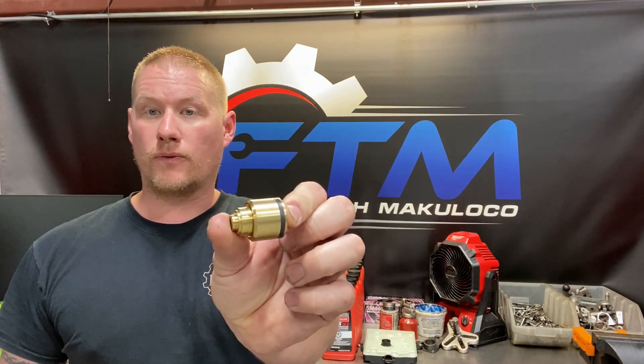Welcome back to the Ford Tech Make It Loco channel. Today we're going to walk you through some more AC diagnostics, concentrating on the Ford scroll compressor with manual refrigerant control valve in the rear. Ford generally uses TXVs and FOTs but not anything inside the compressor. They used these on the 05 to 07 Ford 500, Ford Freestyle, and Mercury Montego, the 08 Taurus and Taurus X, and also the 05 through 09 Ford Escape hybrid version only.